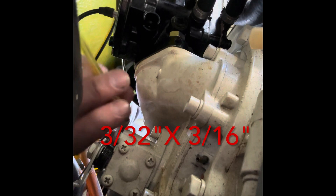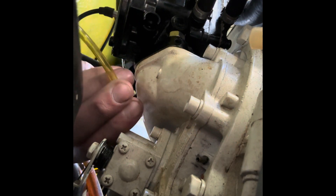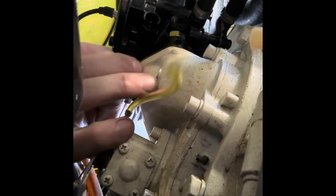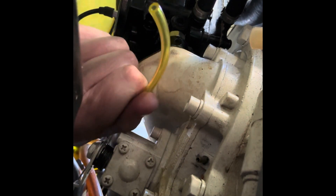Be sure to check the underside of your motor. We're looking at the right side towards the rear by the driveshaft. This line is totally hidden from view. I've had these Sea-Doos for a while getting them running and had no idea this was there — it totally could have fried one of my cylinders had I not fixed this.